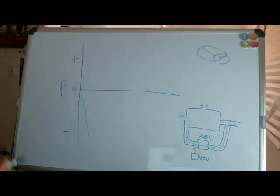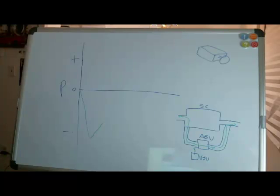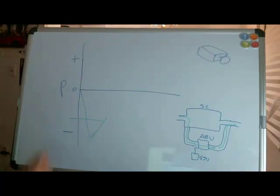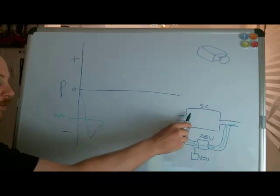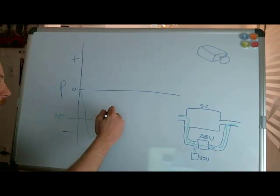Next I'm going to increase my throttle — push down the gas pedal and open my throttle — so my gauge pressure is going to increase. At a certain point, my gauge pressure passes about 8 psi of vacuum, and the computer tells the electromagnetic clutch to engage. Now the supercharger is spinning and drawing power from the engine, but the air is still bypassing through my air bypass valve — not going through the supercharger. So the supercharger's not doing anything yet.